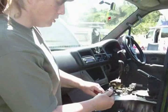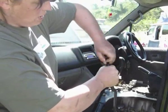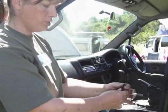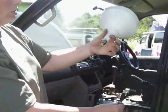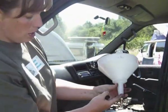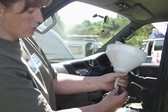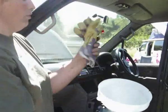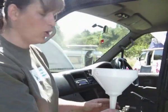Get a pair of pliers — or if it's a Jubilee clip, undo it — and slide that back. Then pull out your bung, which won't always be as easy as that. You might need pipe grips just to hold the pipe and give it a twizzle. Then you need a funnel — any funnel will do as long as it's nice and big. You can cut the bottom to a diameter that fits nice and tightly over the hose and makes a good seal. Have a pair of gloves on standby, preferably waterproof, because you might well be getting hot coolant dripping on your hands.